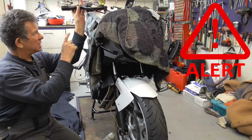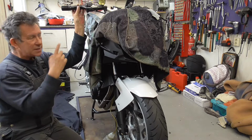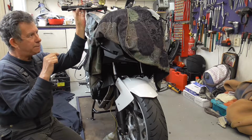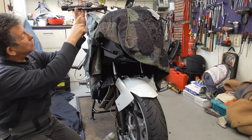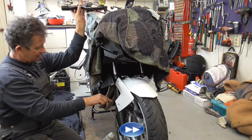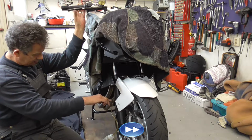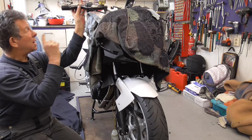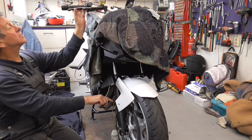Always be careful. Some brake pumps shoot out brake fluid while pressing the handle. So yeah, always be careful. Sometimes they make a tiny iron piece above it. So that's good. Okay, you see it moves over there, but it's not dangerous. Keep the level of the reservoir, otherwise you pump air into the system. That's not good.